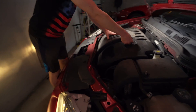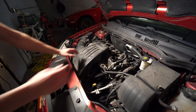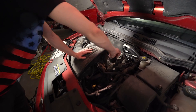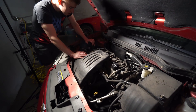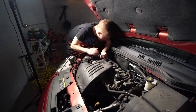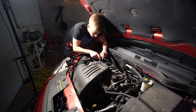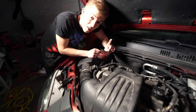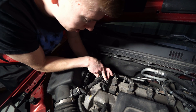To access that, you undo your oil fill cap, take this plastic cover off, set it aside, put your oil fill cap back in, and proceed to locate the exhaust actuator, which is on the rear of the engine — that is the exhaust side, this is the intake side. There are two right here, one on the right, one on the left, and they are different part numbers.